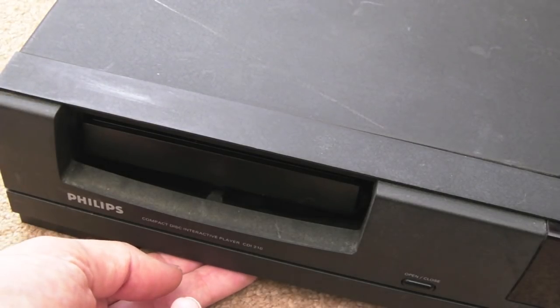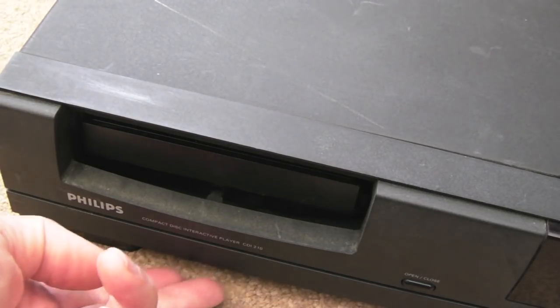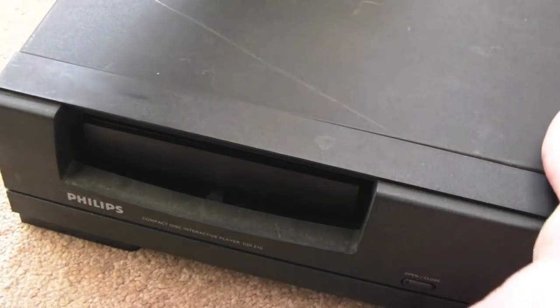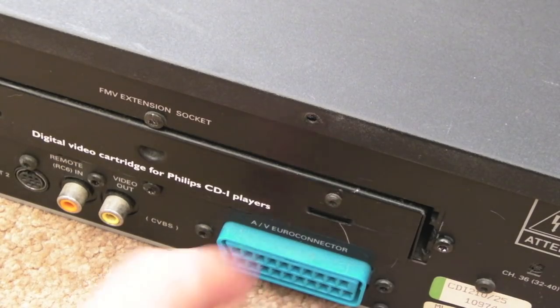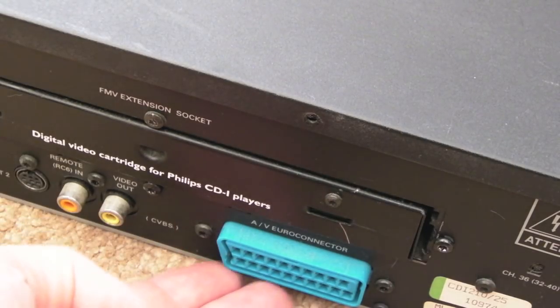And then of course you need a CRT if you're going to use the light gun. It would work with my monitor here. All the PAL ones, I think, if you look around the back, we've got RGB, so we've got SCART, and as far as I understand, this outputs RGB. The American ones don't, so you have to do a mod to get RGB.